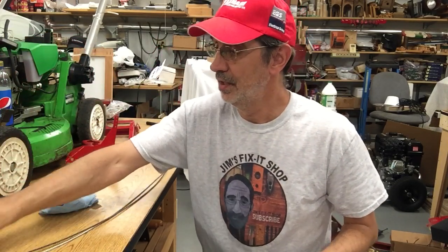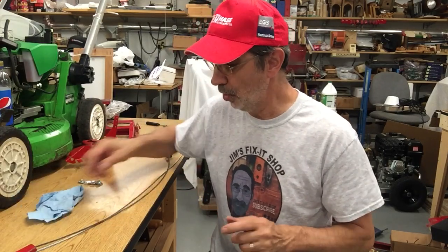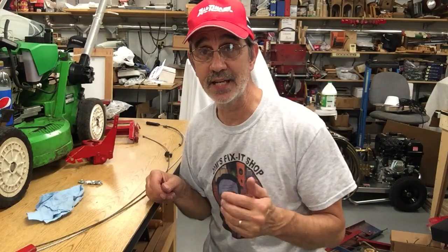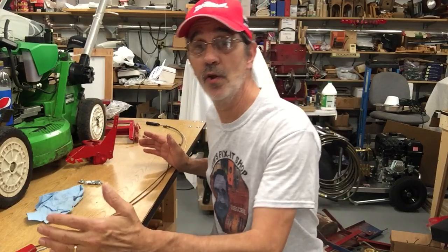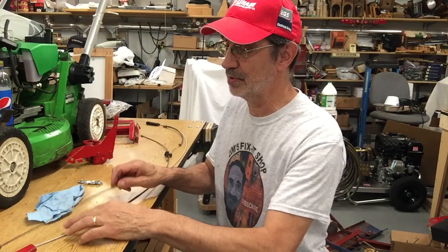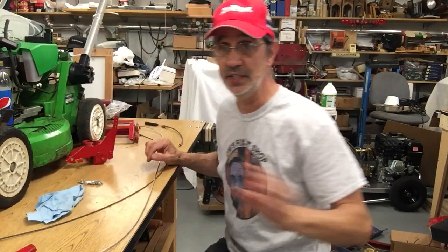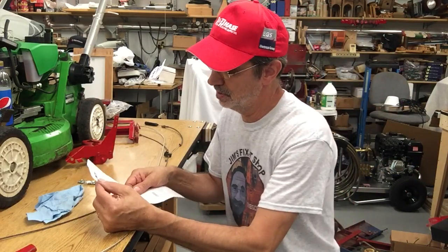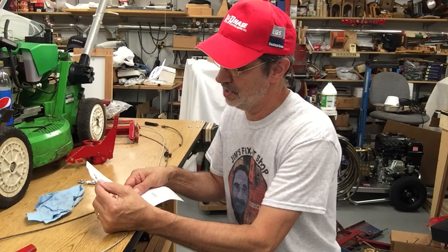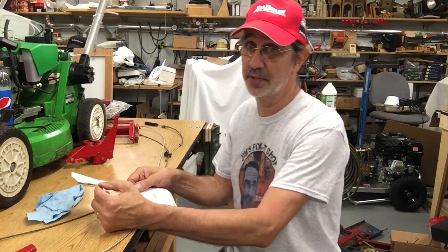When your cable breaks, stretch it out and measure it, or you can go online to partstree.com with your model number, look up the clutch cable, and about 90% of the time the description will tell you how long it's supposed to be. I went down and bought six feet of one-eighth inch steel cable for two dollars and seventy cents — a whole lot cheaper than buying a forty or fifty dollar cable from one of the suppliers.